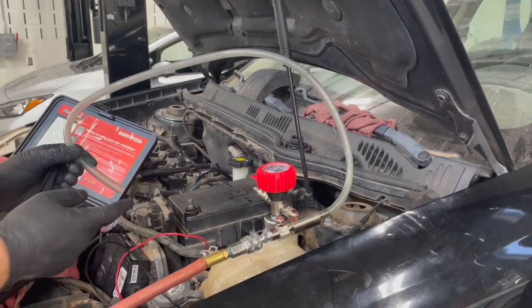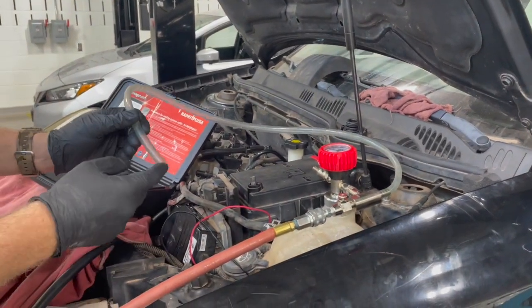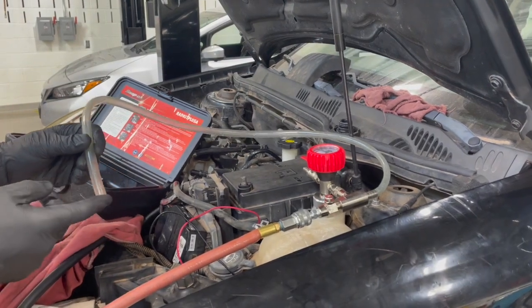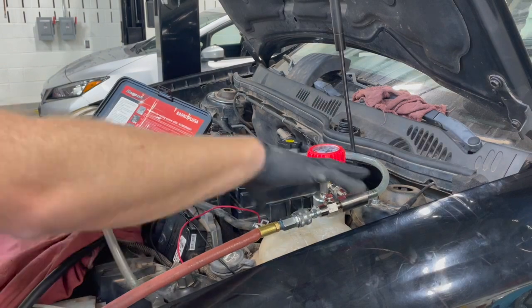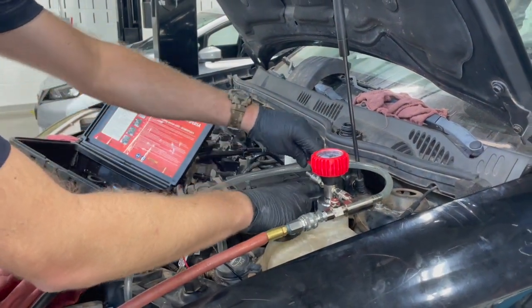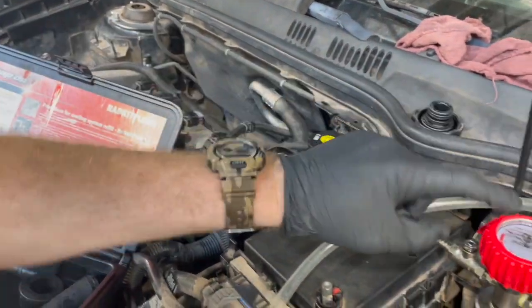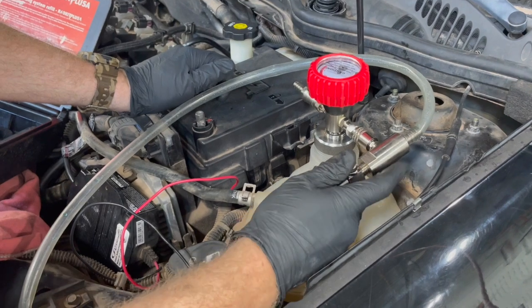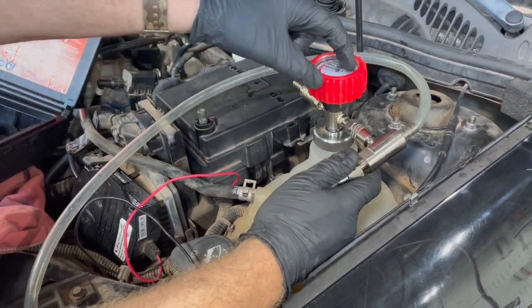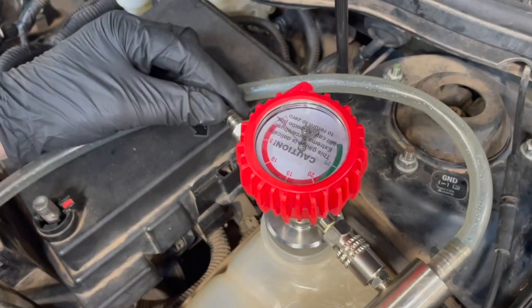It does have this discharge hose — this thing will make a little bit of mess. If it has an overflow bottle or you have a drain pan, it's a good idea to direct that into the drain pan while this thing's sucking down the vacuum on the system. You've got to have this ball valve closed for the delivery side right here. We're going to press the button, and that's going to start the air to make a vacuum on the cooling system. We'll watch this gauge — what we're shooting for is to get it out of the green, so 20 to 25 inches of vacuum or so.